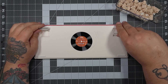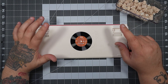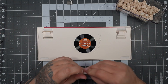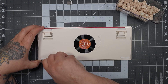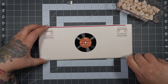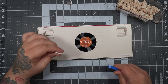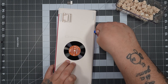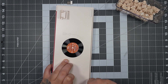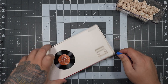Next, we examine the top and underneath the feet to make sure there are no screws. To get into the keyboard, we need to separate it using the pry tool to pop the clips, running along the edge across the bottom all the way around. The included pry tool wasn't quite getting the job done — it didn't have an aggressive enough angle to pop the clips, just slightly separating the case. We switched to a second pry tool with a more exaggerated angle, and that did the job with no problem. We slid it around all the edges, the clips popped, and there was no damage to the keyboard.